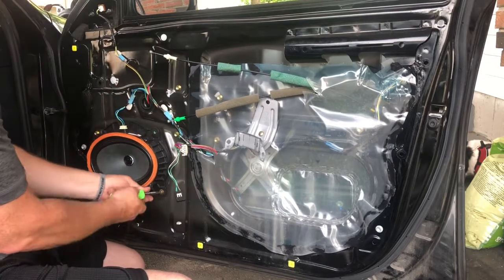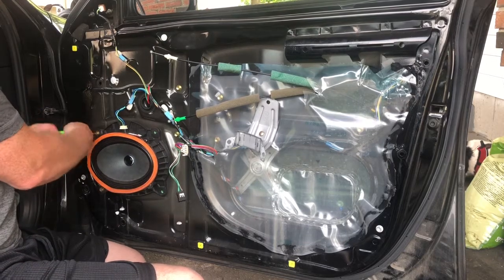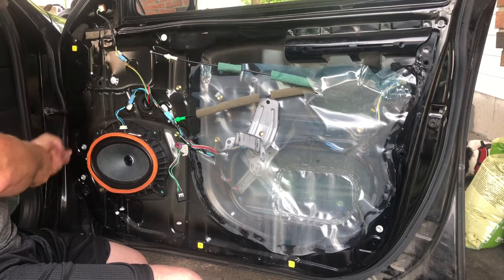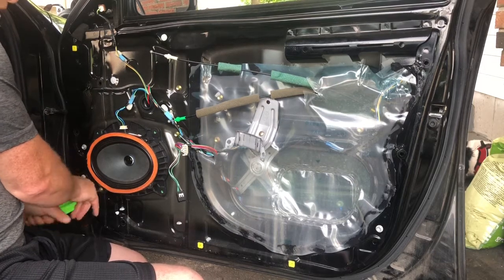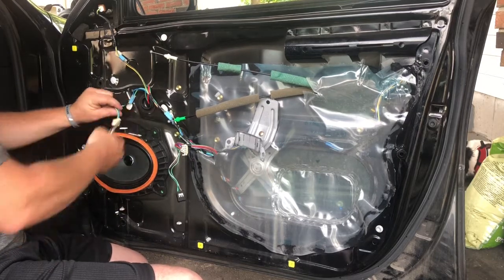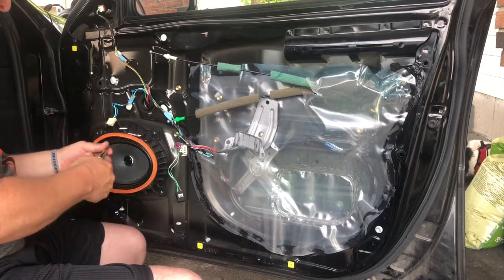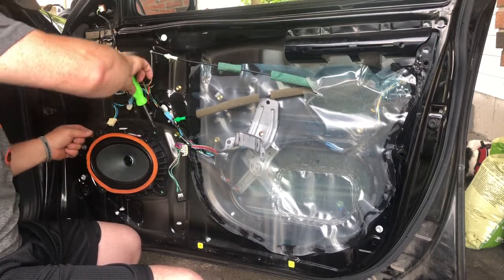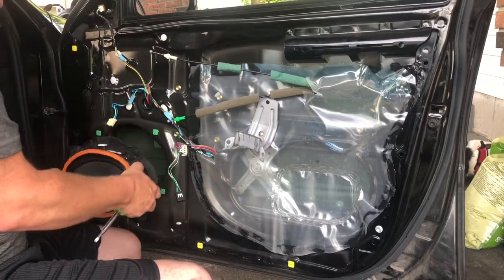They also have a Phillips head on the outside of them. We'll go ahead and take those out. There's also some Phillips heads here for just the speaker. Now I'm taking out, looks like it's 2-piece, but I'm taking out the whole assembly if it's gonna allow me to. And then there's a clip right here. It's just got a little tab on it that you squeeze. It's in there really nice because it's insulated. You can actually hear it unsuction from the car. There we go.